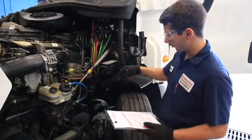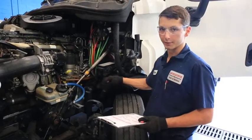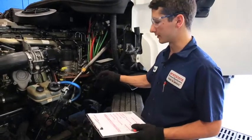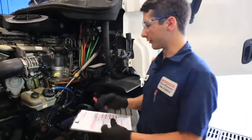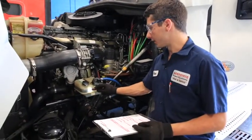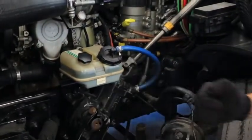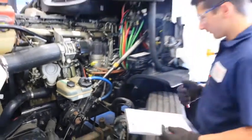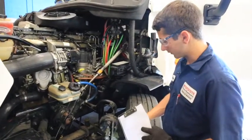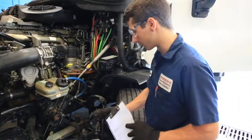While we're up here we're going to check the brake hoses. Make sure the brake hoses don't show any signs of abrasions, bulges, or cuts indicating air leaks, or any audible air leaks. While we're up here we're also going to check the power steering fluid — on this particular truck you can shine a light and see the level is right at the max. And make sure all the steering components are properly greased and lubricated.